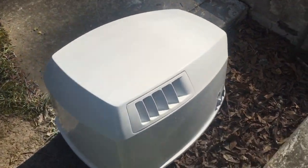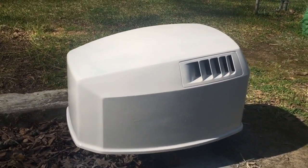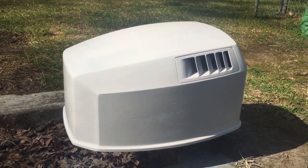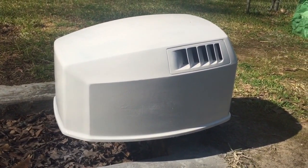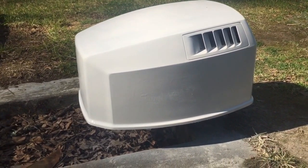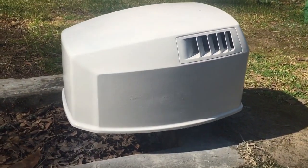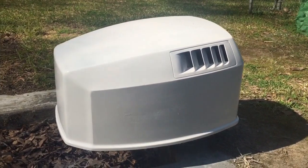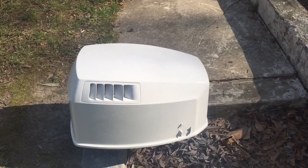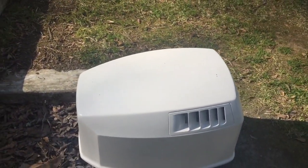Got the first coat of white enamel high gloss on and it's looking pretty good - a lot better than it did before. I'm gonna wait for this to dry. It's got a 15 minute fast dry on it and just keep putting coats on. I'm probably gonna do at least two more light coats and then put her away for about three or four days and let it cure. With the 15 minute fast dry, I might be able to put the clear coat on today - we'll see.